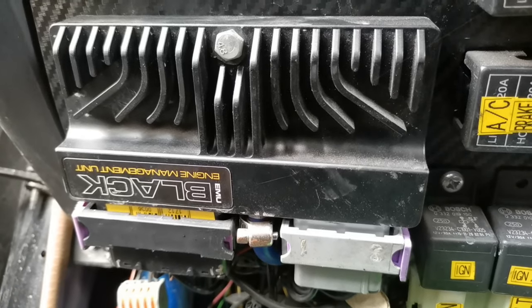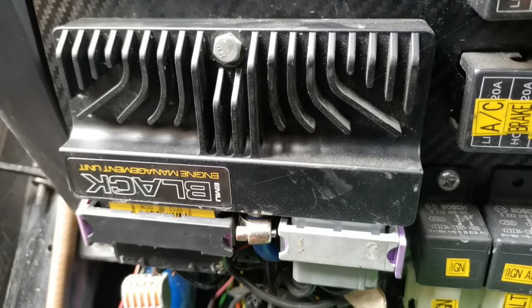But like I said earlier, it all depends on the parts that I have also. Although I'm using the ECU Master Black, that one can support 6 independent ignitions, I'm reusing the 2JZ-GE ignition coils. That one is with a wasted spark configuration. That one they connect 1 and 6 together, 2 and 5 together, 3 and 4 together. All right. And one more good thing for this ECU Master Black is that one can support without igniter or with igniter. So you just need to specify it in the ECU Master program.